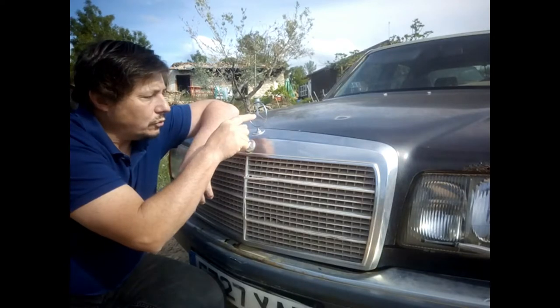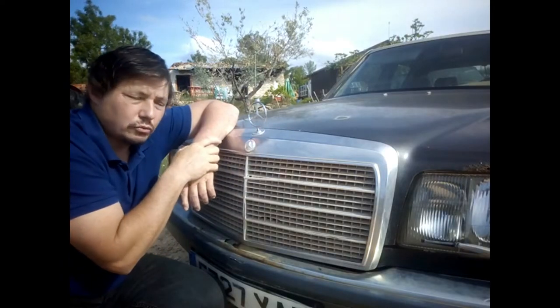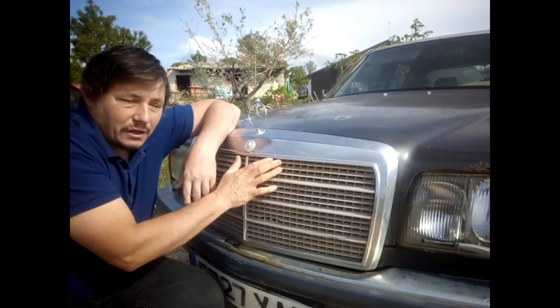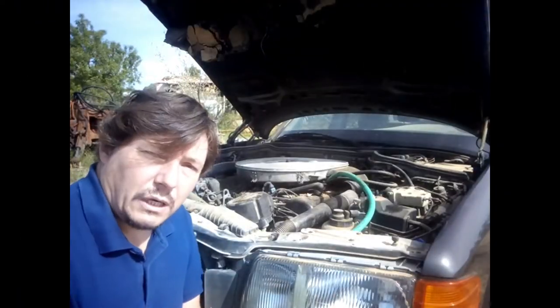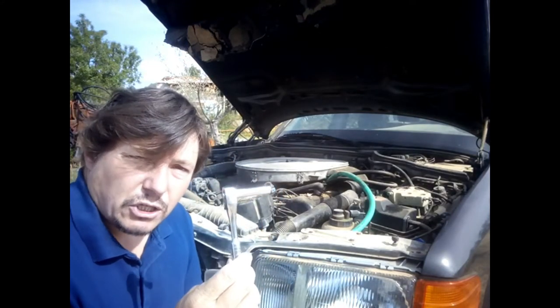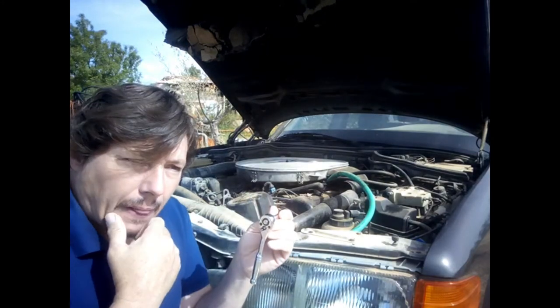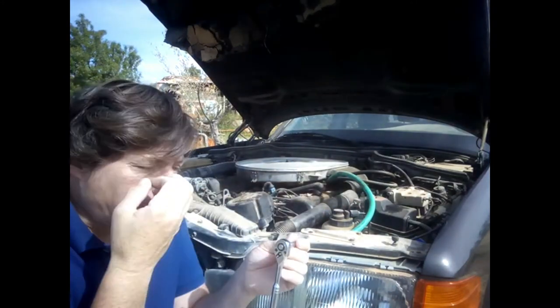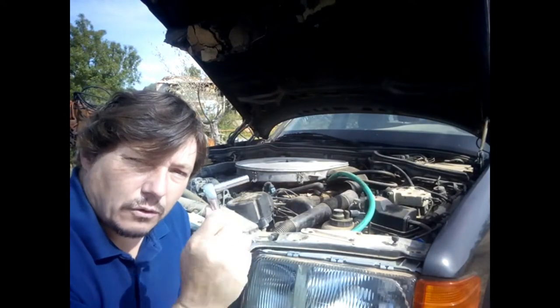Please note that if you just want to change the star, you don't have to remove the grille — it's possible to remove it without removing the grille. But as we're going to remove it anyway, I'll show you how to do that as well. So let's open the bonnet. For tools, we need a pair of pliers — nothing fancy — and I use a ratchet with an 8mm socket. You can use a flat spanner but a ratchet is a bit easier. As long as it's number eight, we're rolling.